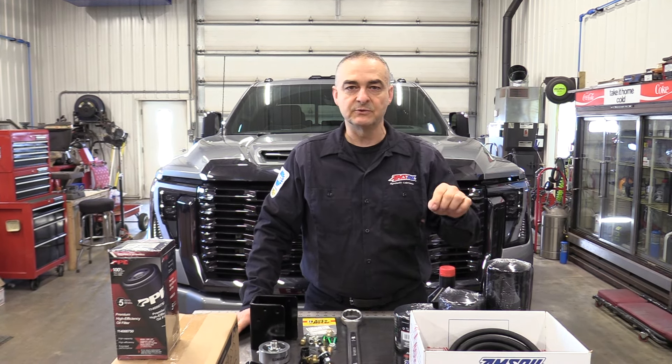For reference, I've got a concrete contractor here in Iowa with a bypass system on their truck. We're on our fifth oil change, running about 25,000 to 27,000-mile intervals. The last oil sample at 27,000 miles showed basically no oil consumption — it was still full — and soot was at half of one percent, with wear metals in excellent shape.